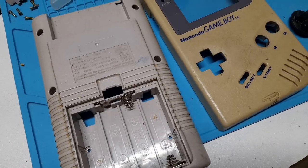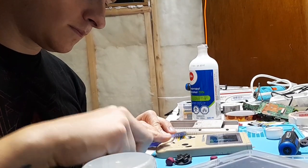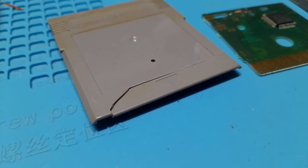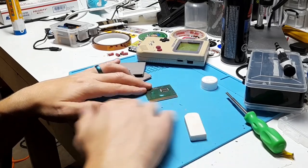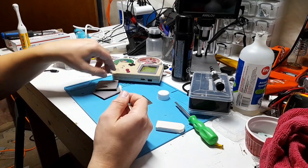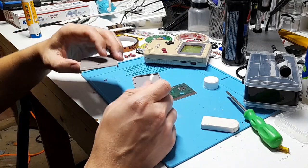Even though I wasn't able to save the screen, I'm still going to clean and restore the Game Boy to the best of my abilities. Speaking of those 33 years, this has built up some grime. I used a toothbrush and isopropyl alcohol to really scrub out some of that dirt, then moved on to the game cart. The cart itself was cracked and the pins were a little tarnished, but we can fix that. My favorite way to clean games is by using a rubber eraser to polish the pins, then some alcohol for a final cleaning. I used a Q-tip and more alcohol to really get into those nooks and crannies.